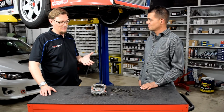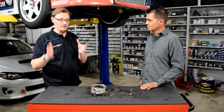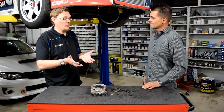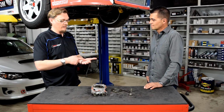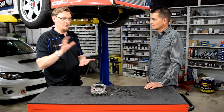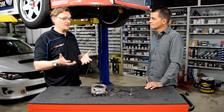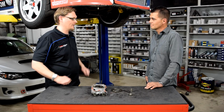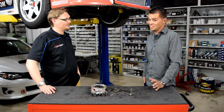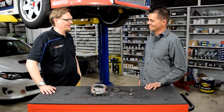Right, and that's where it's so awesome that you did that, so that you have some real world information for everybody to know at least what you went through. And so if you've got the pump, the pressure and the temperature gauges, you can compare what you're seeing with what you ran, and make a decision: do I need just another shim or do I actually need another pump? Exactly. Or do you need to take your engine apart? Let's hope not.